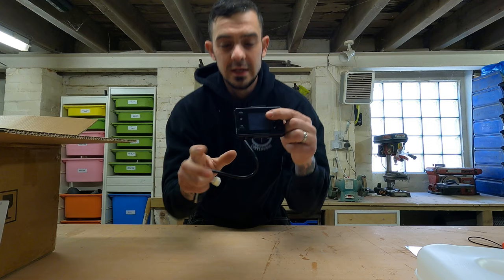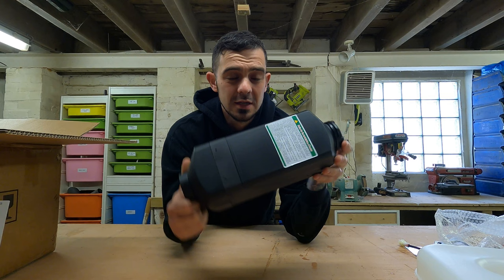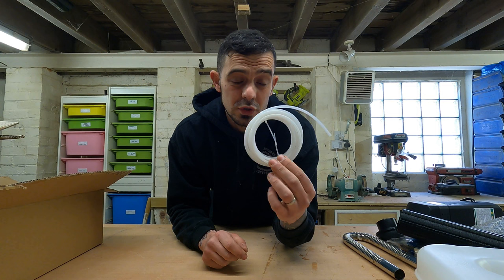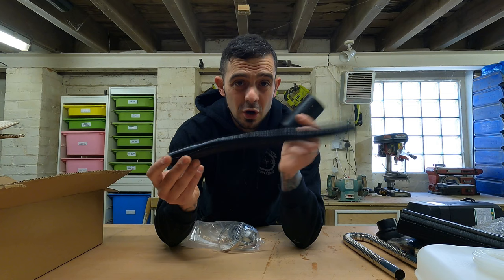This is your fuel pump. This is your control panel and remote control. This is the night heater itself — this is a true 2kW version. I'll explain a little bit more later about telling the difference between the 2kW and the 5 to 8kW, which is actually a 5kW. This is your exhaust pipe and muffler. These are your air ducting pipes and vents. This heater comes with the white fuel line, which is the better fuel line to use. If your heater comes with green fuel line, I recommend changing it out for the white solid fuel line. This is for your combustion air intake that goes underneath the heater.